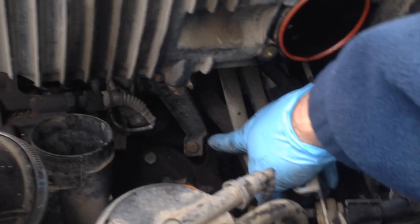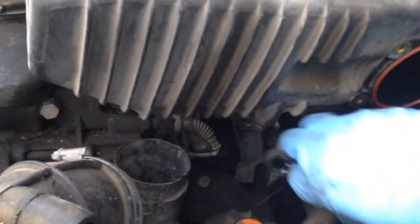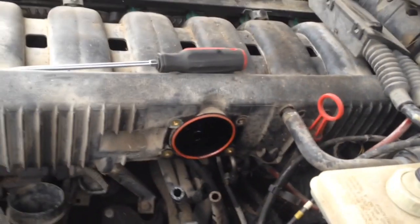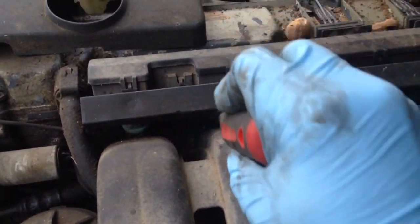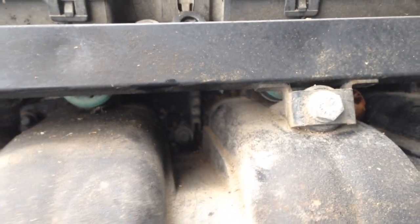What that exposed was you can actually get to the bolt to this bracket down here, and there's another bolt right there you have to take out - those are the two main support brackets. There are a bunch of hoses, and next we're going to go up here and pull out all the bolts up here and disconnect the fuel rail and all that stuff next.